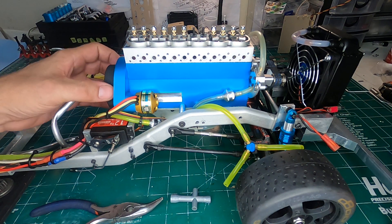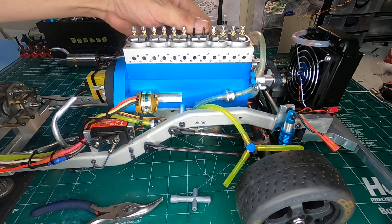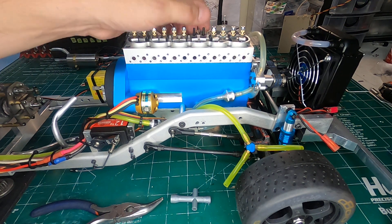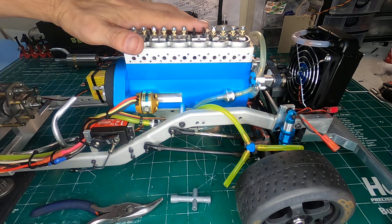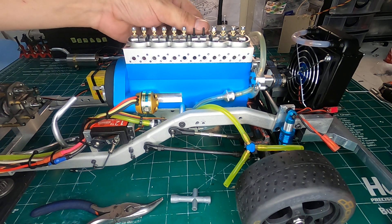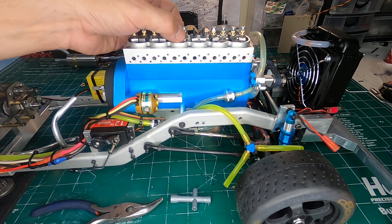I already have this in position to work on these two valves right here. If I take my thumb or finger and feel back here, these feel like they're both the same, so they're closed. And this one feels like the exhaust valve is a little bit open.